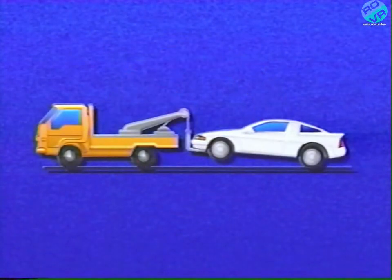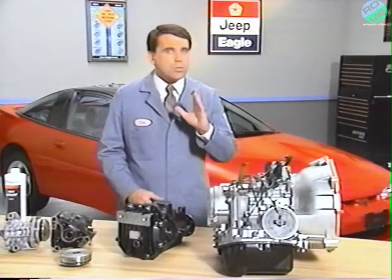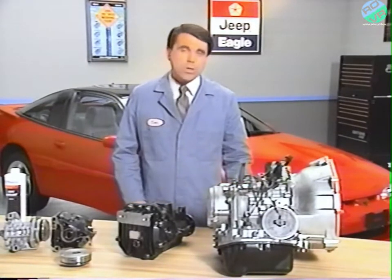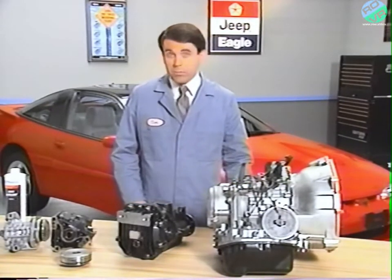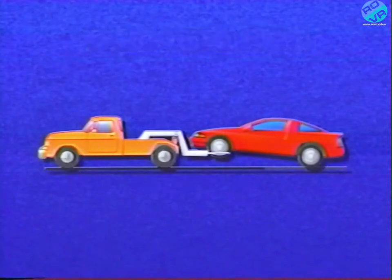You also should not use a sling lift to suspend one of the axles. Doing so will damage the bumper and cause lubricant to leak out of the transfer assembly. By the way, you shouldn't use a sling-type wrecker on front-wheel drive vehicles either. Doing so may damage the axle or the bumpers. On front-wheel drive vehicles, use a wheel lift-type wrecker and pick up the car by the front wheels whenever possible.